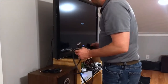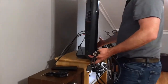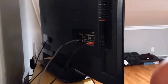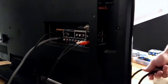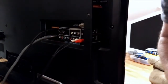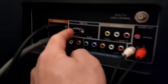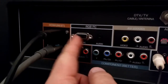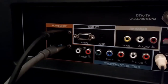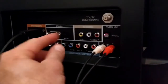I would find on the back of the TV a VGA input. This TV has both HDMI and VGA, so I would use HDMI — that's definitely the first choice — but if I didn't have HDMI I would find the VGA. It's also labeled RGB or PC; that's the computer input. That's what it's going to look like — a monitor input on the back of the TV.